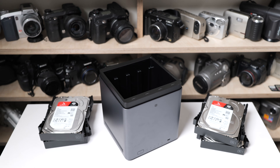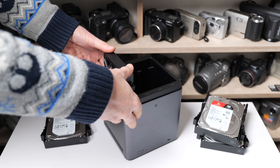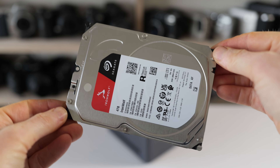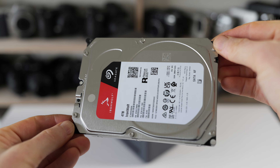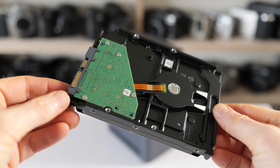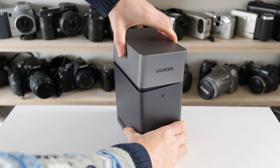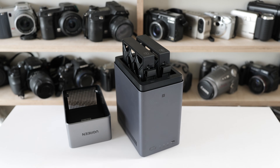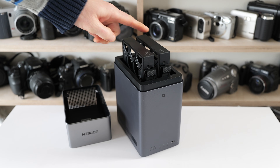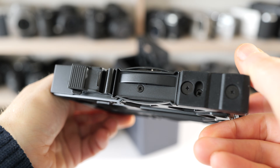So let's set them up. Like most NAS units, you do need to provide your own drives and you base that on how much storage you actually need and how much protection you want against any of them going wrong. You can use standard 2.5-inch or 3.5-inch serial ATA drives, but ideally go for matching models and ones that are designed for NAS units that are generally left switched on all the time. I used 4TB Seagate Ironwolf hard disks for this test. Lifting the cover on either unit reveals their drive bays with the disks fitted into trays that slot into the NAS vertically. Ugreen provides screws and a tool to mount 2.5 or 3.5-inch drives securely into these trays. Note, Ugreen doesn't mention hot swappability so to play safe you should only insert or remove drives with the unit shut down and switched off.